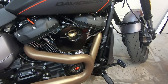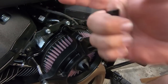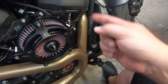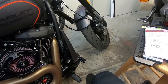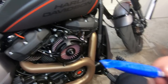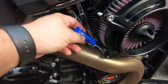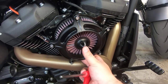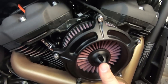Put that little extra plate piece in — don't drop it — and then we put the filter on, which holds all that in place. Take these little pieces and thread one on lightly just to hold it up, then remove each one, put a little spacer in, and slowly work your way around. Don't tighten anything down yet because you need Loctite. Go ahead and put little drips of Loctite on each of these, then start tightening it down.